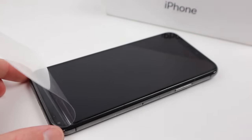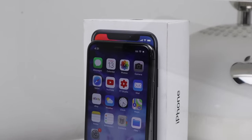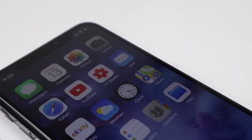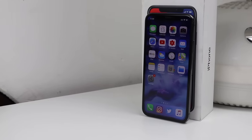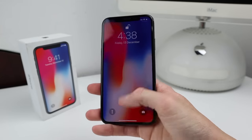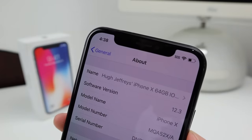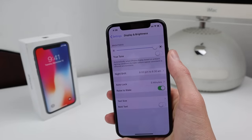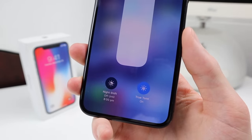We can then remove the protective film and we're done. This iPhone X is now back in working condition and is no longer glitching out all the time. While not a difficult repair to complete, you do need to have the right equipment — like a pro tech toolkit which has the pentalobe and tri-wing bits these iPhones require — as well as a reprogrammer to properly reprogram the display. Jumping into settings, this is a 64 gigabyte iPhone X running iOS 12.3, and as you can see the True Tone function is still functioning just fine after the screen replacement. If you don't reprogram the display, this function will entirely disappear from the phone.